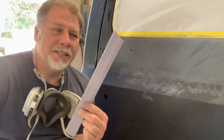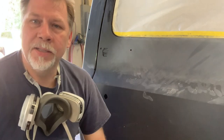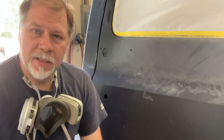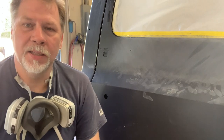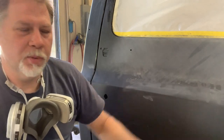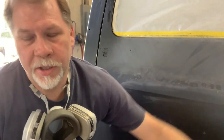So the reason I'm using a stick is I still want it straight, but I don't want the long stick that I use to find all the dents and things like that. At this point, it should be very straight. It's kind of time to start rounding everything together. The final prep to paint is where you round everything together just slightly. The body line that we've been keeping really, really crisp and straight, we're gonna round that slightly, and that's gonna make it look even straighter.